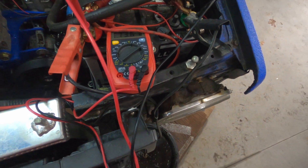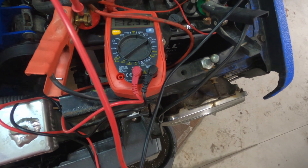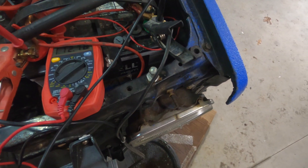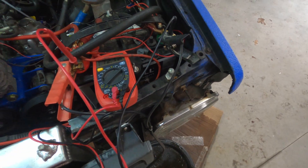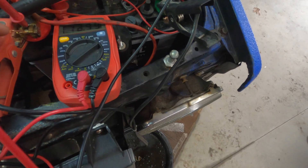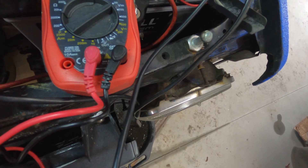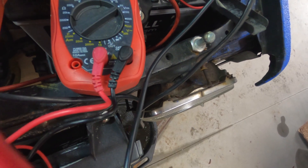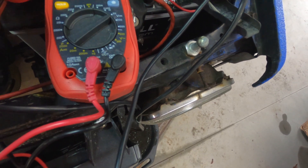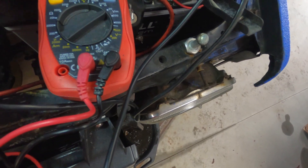That's 13.4. I turn the battery checker off and then it drops — I just hit the battery and it's dropping immediately. And now what should happen is when I take this resistor, it should see the voltage and start charging. Which it seems to have done — has it healed itself? It seems to be working now.